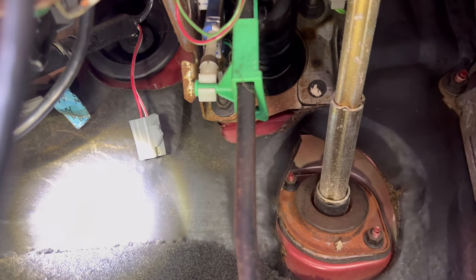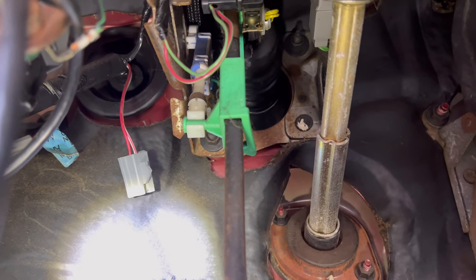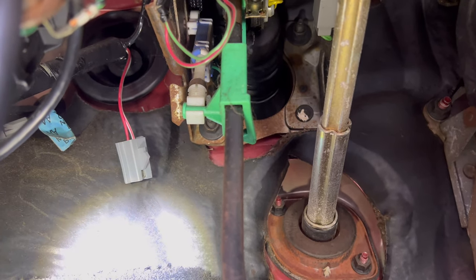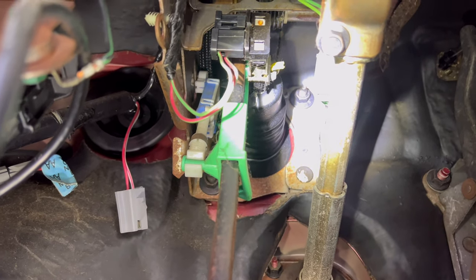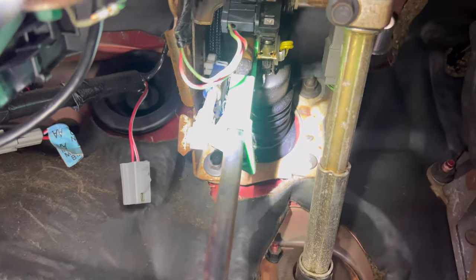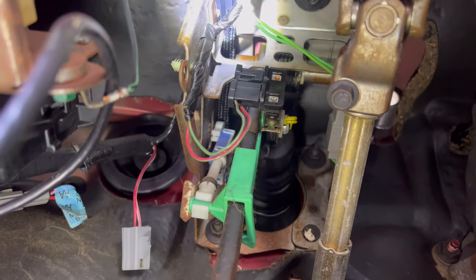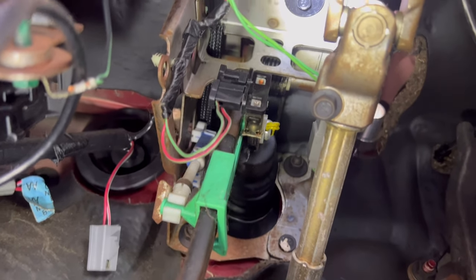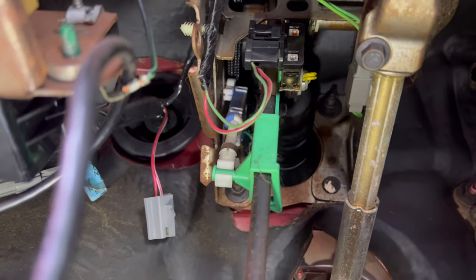So now we have a plethora of wires on here. This harness right there — that little plug the lights on — that goes to your clutch pedal. And this plug right here goes back onto the brake pedal. There's a harness that goes up here to plug in. Here are your four bolts to pull the assembly out, and then there's one more screw right there, so we're going to be swapping that out as well.